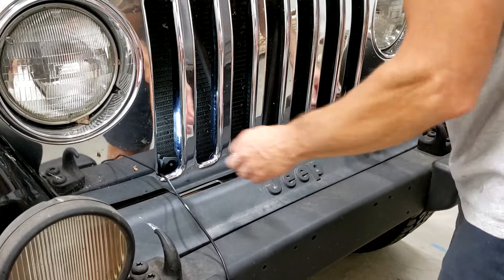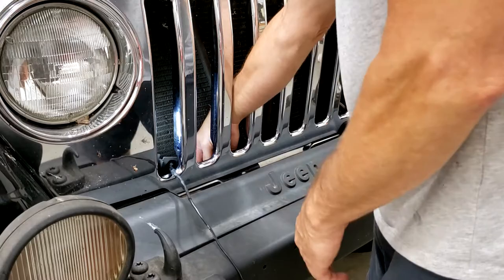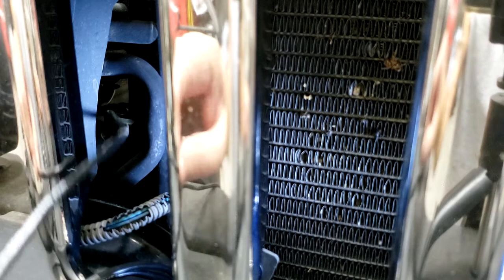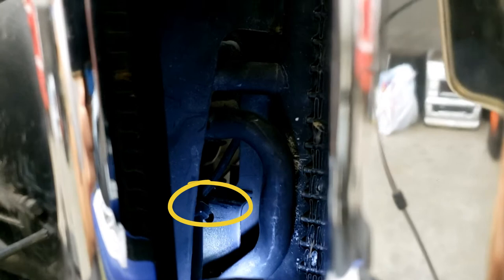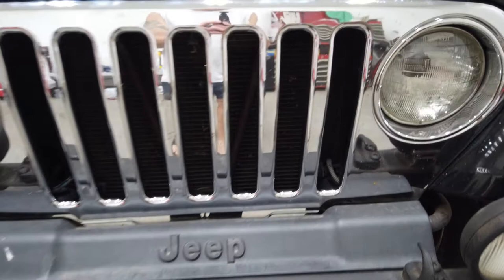It's actually a little entertaining — these things are magnetic so they're sticking to everything along the way. We've got a metal grill on this LJ and the lights grab hold of everything on the way through. You want to keep your lights and wiring patched away from the radiator. Now we're going to feed our wire up through that opening, take it right up through that hole, and pull the wire all the way through. So we've got the grill lights installed.